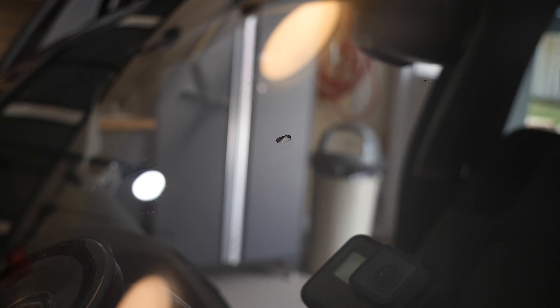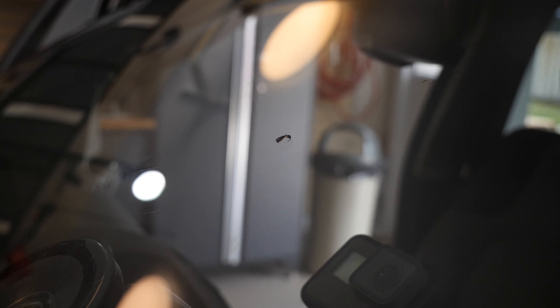Just like last time, we want to grab our device and back it out. You're going to get some spillage and that's okay — just have a paper towel ready to soak it up. Then pull our mount off and set that aside. Now we want to grab our resin and a curing sheet and do that one drop right over top of the mouth of that crack. Put our curing sheet on it. Back out into the sun, 15 minutes, and then come back in, scrape it off and we are done.